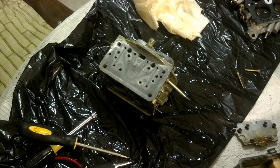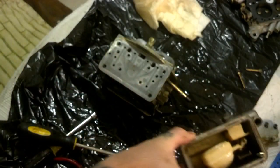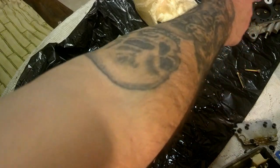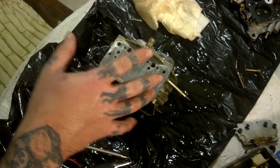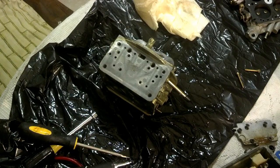Now the next part is me dipping all these parts. We took the part and finished disassembling — that's all I'm going to show you because I've got the dip and it'll take some time. When you dip your parts, you want to use this carburetor parts cleaner — it comes with a little tray and everything. Don't dip anything plastic. When you do your float bowls, take everything out of them and clean them good. Same goes for everything else. If you dip your bottom base plate, make sure you complete the disassembly. If it's not leaking I don't recommend it, because the plastic bushings and everything are a pain. Clean it out with compressed air, brake cleaner, however you want to do it. That pretty much completes the disassembly of the Holley.